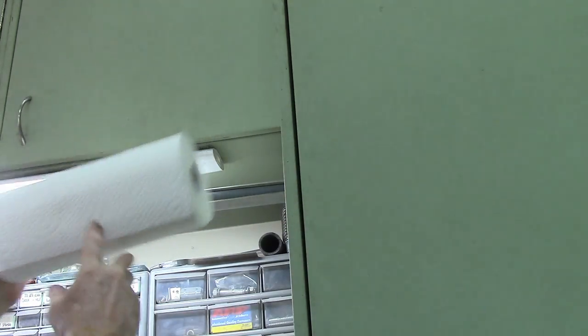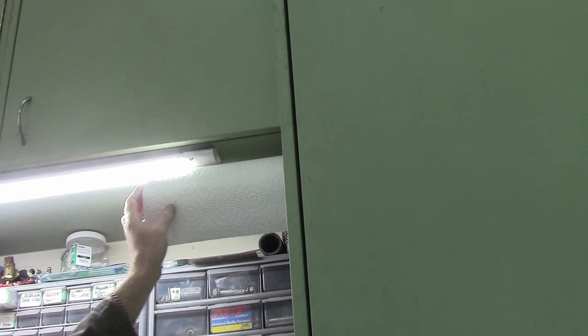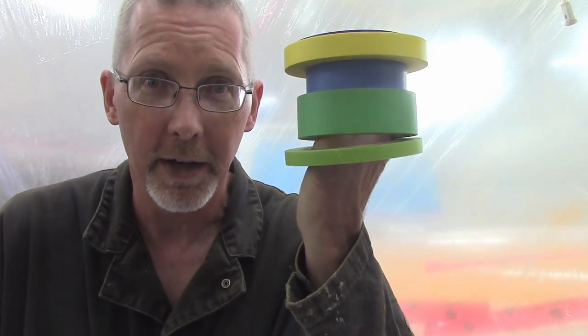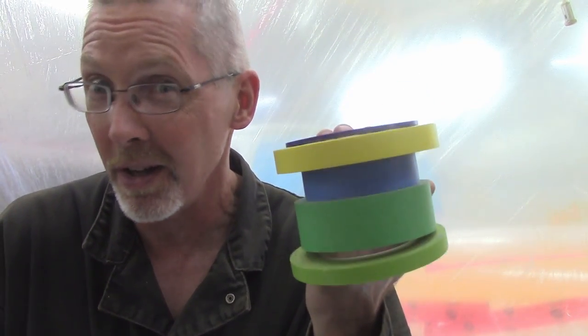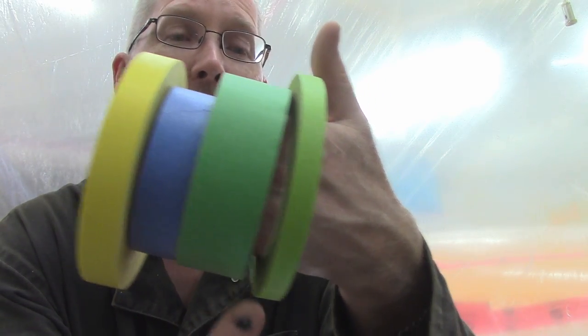When they go on sale I buy one or two and run them till they die. For little bits and touch-up stuff I like this — not a lot of overspray. It comes with a 0.8 tip but I did take an older tip and drill it out to 1.2. These are on sale for about 40 or 50 bucks. You're going to go through a lot of paper towel for wiping stuff down. You're going to want to get yourself a bunch of paint filters and paint strainers — you pour the paint through this into your paint gun. There's a fancy stand that you can use to hold all of this. I bought these off Amazon — they're just a little bit small but they do filter and that works good.